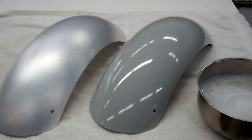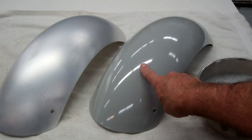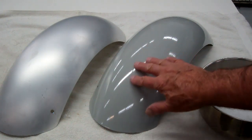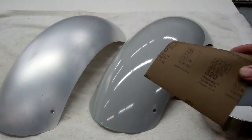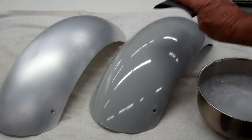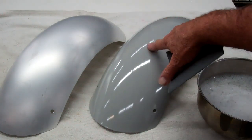This will be just a quick note on your fenders. If you purchase the primer fender like this one, what you need to do before you paint it is just scuff it a little bit with some real fine sandpaper or like a 3M pad. Use wet or dry paper if you can — it's usually the black type stuff. Be sure to wet it a little bit and then sand the fender just lightly. Don't go through the primer. Just sand it smooth and then it should be ready to paint.